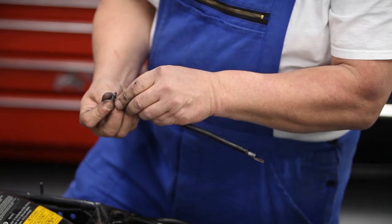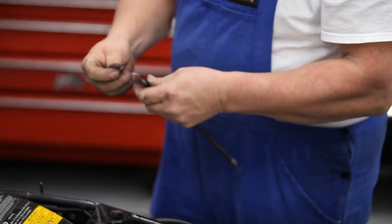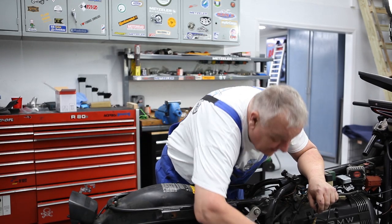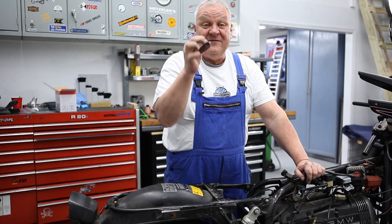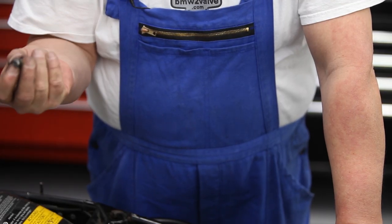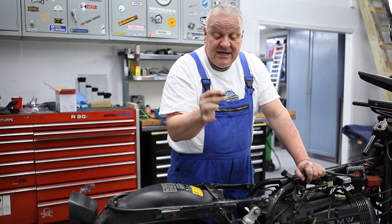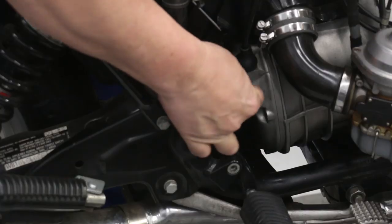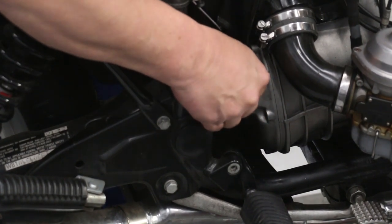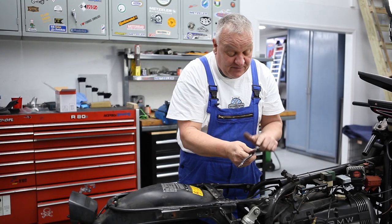To do that I'm going to cut a little piece out of the middle and make sure it fits over the bolt — needs to be just trimmed a little bit more. Now I can put this bolt back in. By the way, this is the vent bolt for the gearbox — make sure you have a bolt like this with a hole in it and that you can actually see light through it. This is the correct bolt for this application.